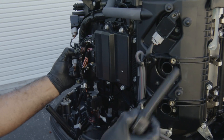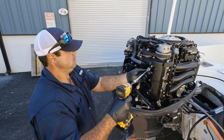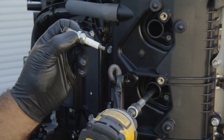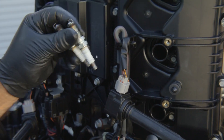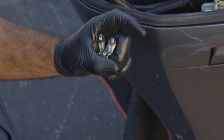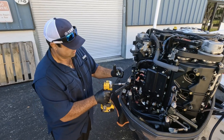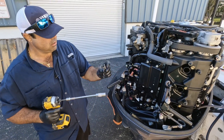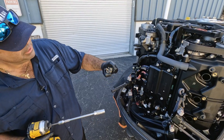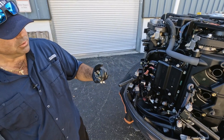This particular model takes a LFR 6A11 — it's a real common spark plug. That base is rusted, so another year from now it's going to be really rusty. But I always like changing spark plugs so you can see how everything is running. Those look like a nice clean burn — you can tell he's using non-ethanol fuel, because with ethanol those plugs would be all burnt, really brown — not a clean burn.